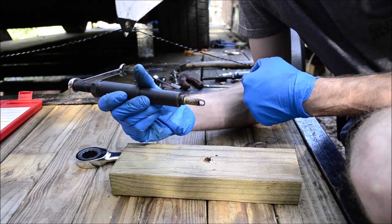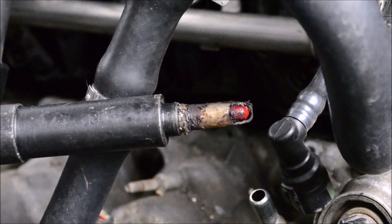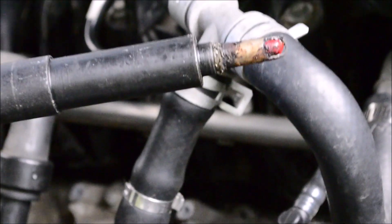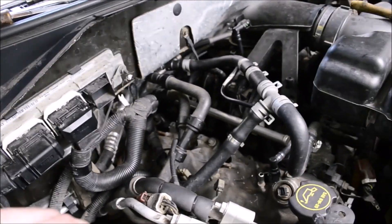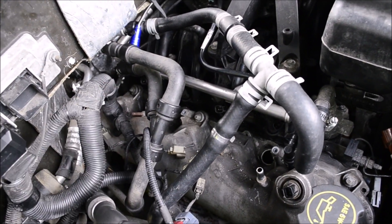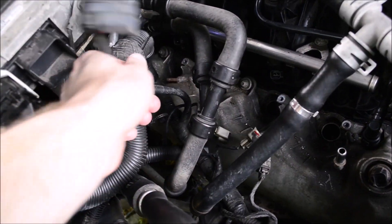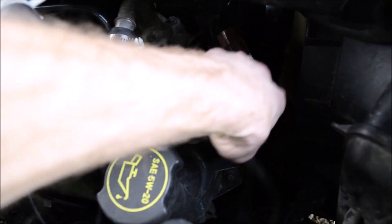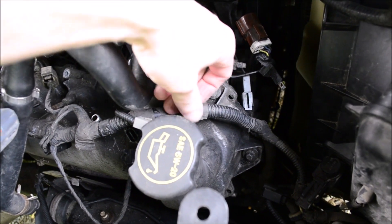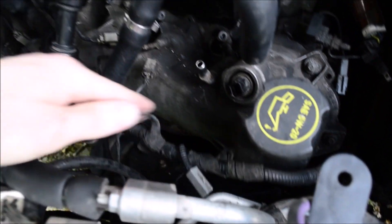That will pull the electrode shield out of the cylinder head. Then you're ready to put in your new spark plugs, and hopefully the electrode shield will be attached to the assembly when you pull it up. Unfortunately, the back one broke too, and that's the most difficult one to get out because of all the pipes and wires in the way. What I did was unplug the wiring harness and moved it out of the way — it's connected up here in its original position, but if you unplug and disconnect it and pull it over the oil fill, it will get out of your way.